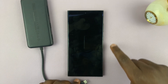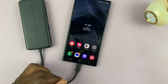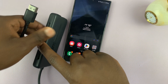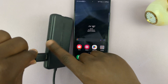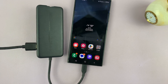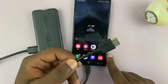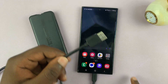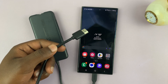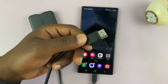It's very simple. All you have to do is connect the adapter to your Android phone, just like that. Then plug the HDMI cable into the HDMI port, just like that. Now you can go ahead and connect the other end of your HDMI cable to a TV or to a monitor. For instance, if you have a Samsung phone and you want to use Samsung DeX wired, you can use it like that. You can even use it to screen mirror your Android phone to a TV or a monitor — this is going to be wired screen mirroring.